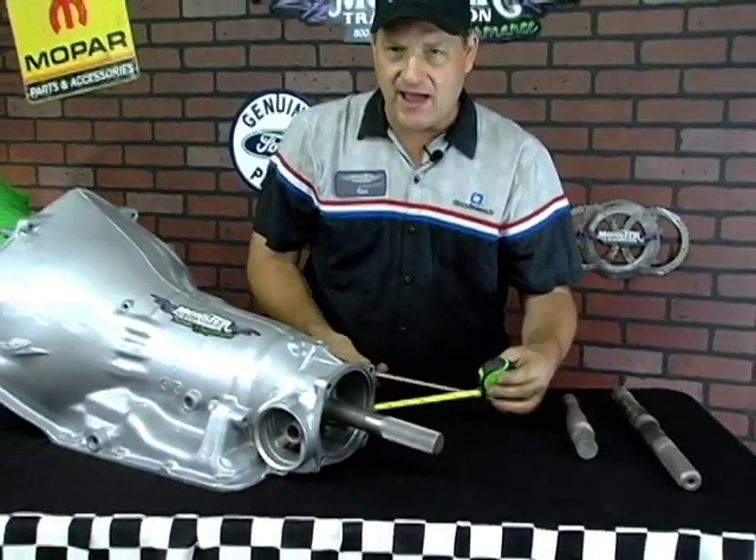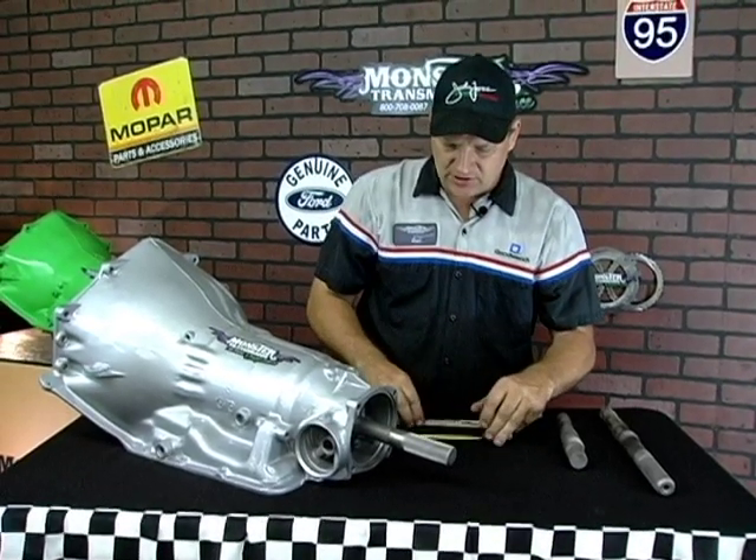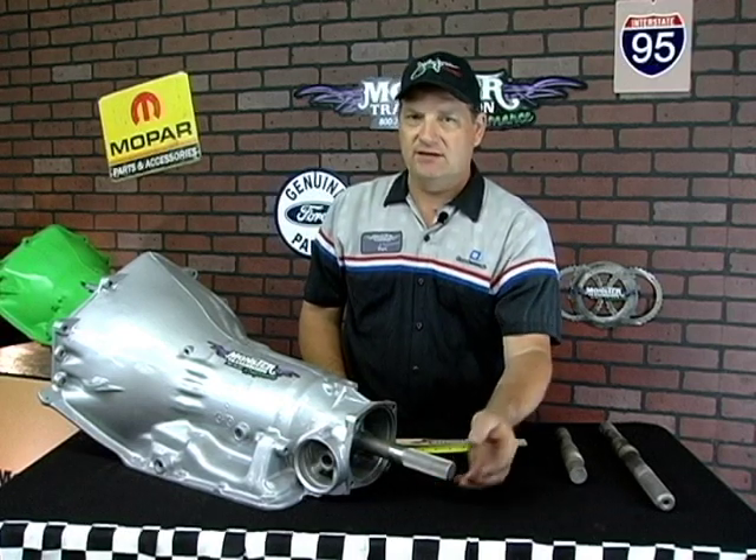Both shafts have been found in all-year vehicles. Particularly in the late 70s to early 80s, they used the longer one. We do need to know the shaft length when ordering a 4x4 transmission. Again, they all came with 27 spline teeth on the output shaft. If the shaft length is different or has a different spline count, then it has an aftermarket kit already installed in the unit.